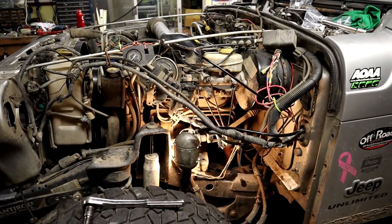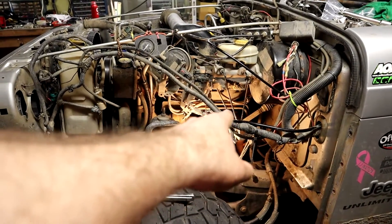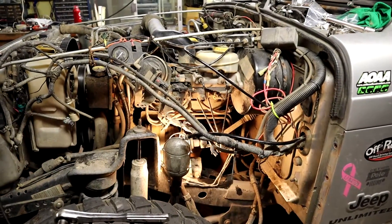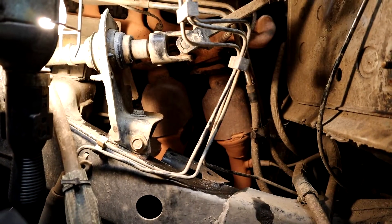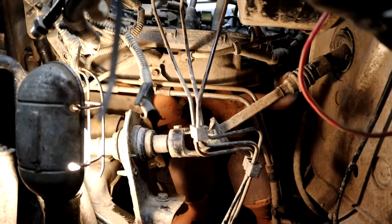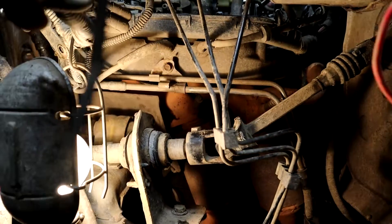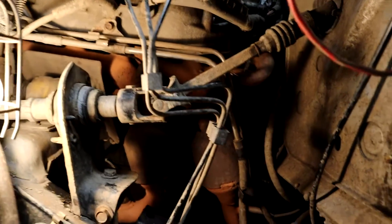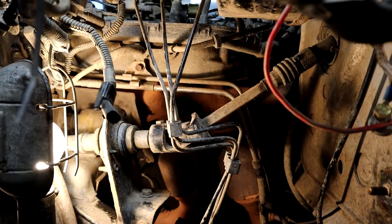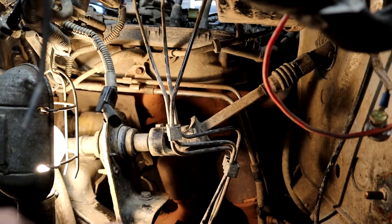So this is the mess that I've caused. Talk about snowball effect folks. My goal - if you look way behind all of this you can see the exhaust manifold - that's what I'm trying to get to. Those two guys there are my pre-cats. Above them, back there, you see that flange behind the steering linkage. I have to get the bolts out of that flange, and then there's a second one. Above this pre-cat is another one. Once I get them disconnected, then I can drop these down pipes - it's a y-pipe. I can take them and drop them just enough to get the oil pan off. All this work to get the oil pan off.